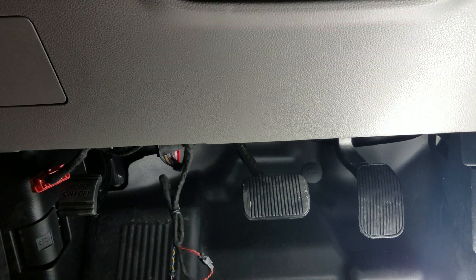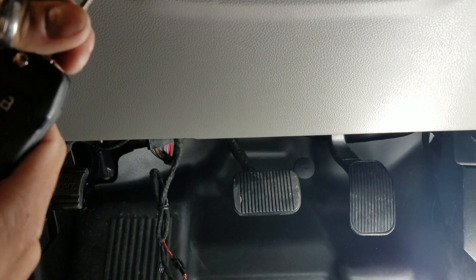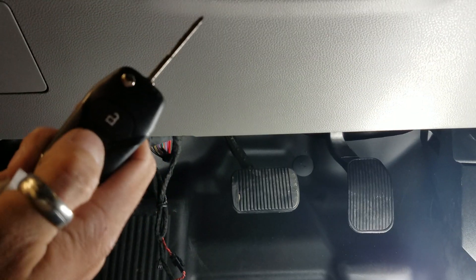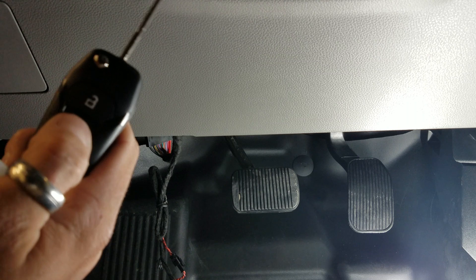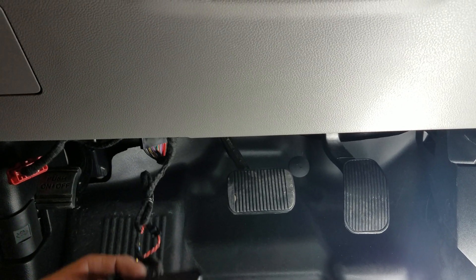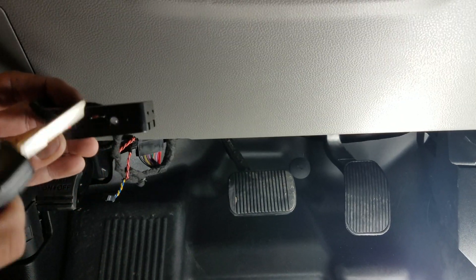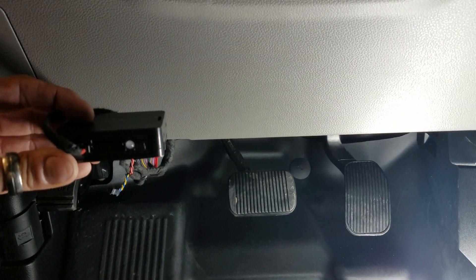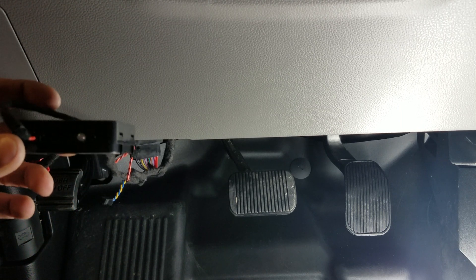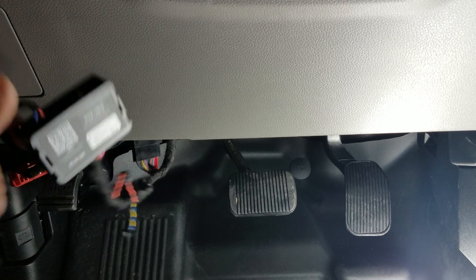Turn the key off — that's done. Now on the key fob we're going to hit lock, unlock, lock. So lock — unlock — lock. You didn't see it, but it flashed red and then it's flashing green to let us know the remote start is active, and obviously there was no horn honk. The vehicle's locked because lock was the last button we pushed. And there it is.